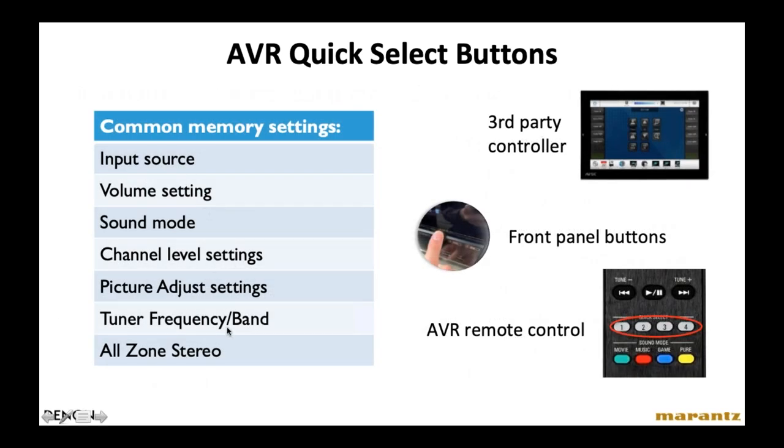The Quick Select buttons found on Denon receivers — called Smart Select on Marantz — are four buttons on the front panel that function as a type of light automation for memorizing macros. For example, if you're watching TV in your preferred surround format at your preferred volume, press and hold the Cable/Sat button and it will remember all those settings. Next time, just press that button: it'll turn on the receiver, select the right source, set the volume, and set the surround format. It's a super easy macro to use. If you're using a third-party automation platform, it saves a lot of steps — instead of programming receiver on, input HDMI 2, surround format DTS, etc., you just program the quick select button. For universal remote users, it's a unique IR command that's easy to program in.